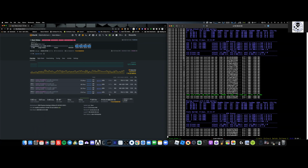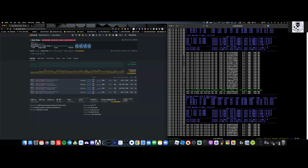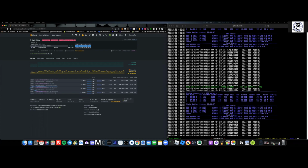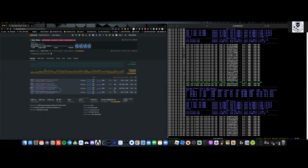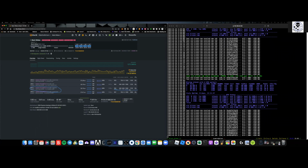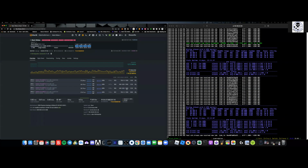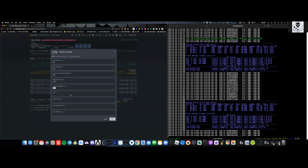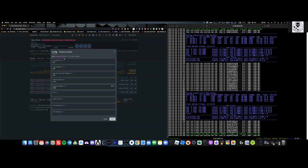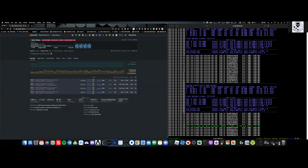And when it comes to setting these, right, I mean, this was very, very tricky. I did have to come in. The easiest one was my Sapphire. I was able to find a lot of people that were using these settings, right? 965 core, 640, 620, 1300 on the memory, 1135 on the memory power and stuff like that. It was pretty simple. This was really what I was able to just copy from the mining community, and this worked out really well. I was finding it stable at just over 32.